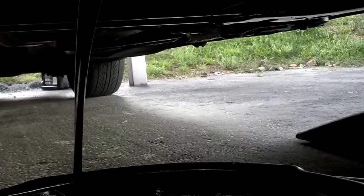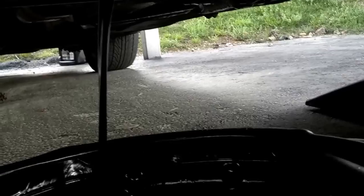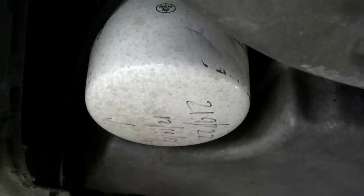Next you want to come down under the car. About two feet back you'll see the oil pan, and that's the oil filter there. Right on the back side of the oil pan is the nut that needs to be removed — it's a 17-millimeter nut for draining the oil. I've got my catch pan under it and I'm going to take that oil plug loose and drain the oil. It's best to use gloves when you pull the bolt out. The oil is warm so I don't want to get burnt. If I drop the oil bolt into the pan I use a magnet to fetch it out. Then I'll take the oil filter loose with the oil filter wrench — because of how it's recessed in the oil pan, it's best to use the socket wrench style, but I have the strap type so I'll go ahead and break that loose.